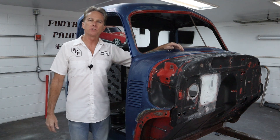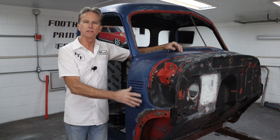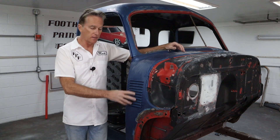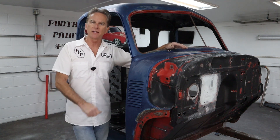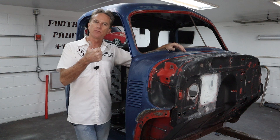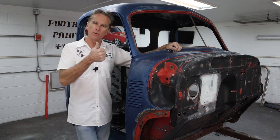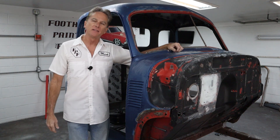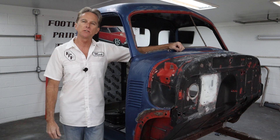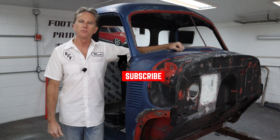That just about wraps up this super quick video on straightening the louvers on the 1950 Chevy truck. Hopefully yours are nice, smooth, and perfect, but this truck is 72 years old and these were actually in really good shape — I only had to straighten five or six of them and they were just slight, it wasn't a big deal. Try your thumbs first and massage those things out, then move over to a piece of wood or maybe a screwdriver at the very end, and you can get them looking good just like these. The next thing for me is sanding in between all these. Thanks for joining me here at Foothill Paint and Fabrication. If you just started watching the channel, please consider subscribing, and if you like what you saw, give me that thumbs up — it really helps promote the channel. We'll see you on the next one.